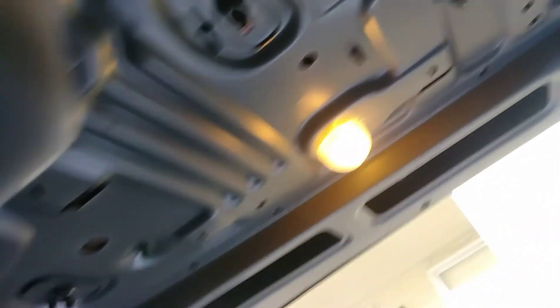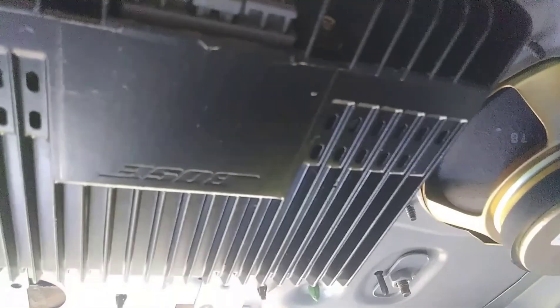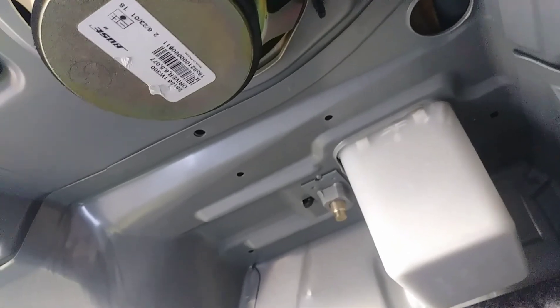We're going to fold down the back seats, get in here, and take these panels off. Under here there are some clips — take a pair of pliers and squeeze them. Those are the factory Bose speakers, which are in decent condition. I did not get the factory connectors, so I'm going to cut the wires, solder them, and keep these plastic ones in case I sell the car later and need to put the factory speakers back in. This is the factory amp for it.